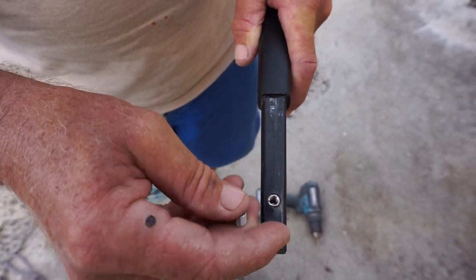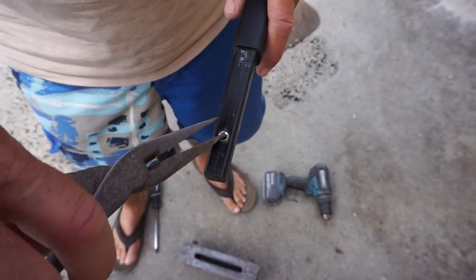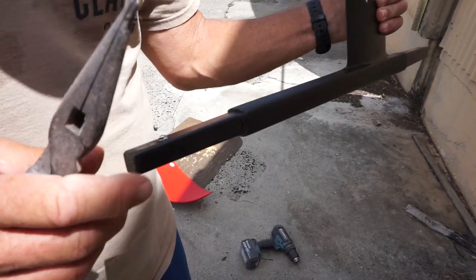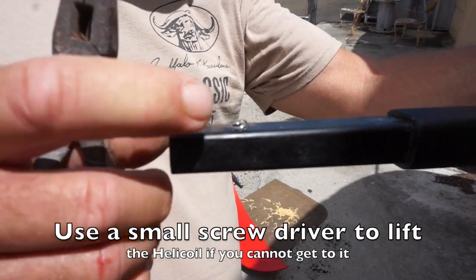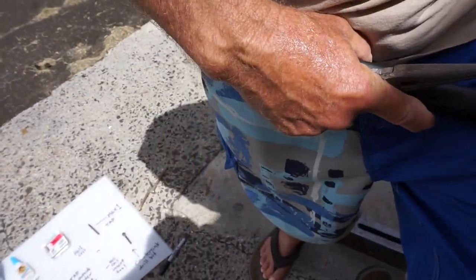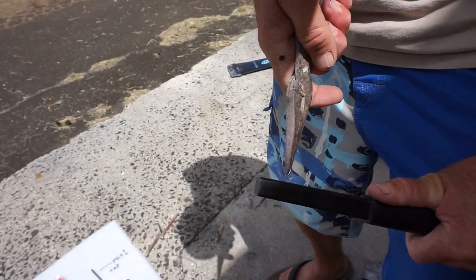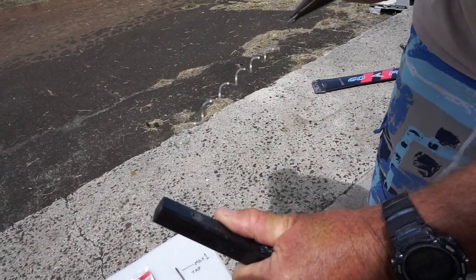So I'm going to grab my needle nose pliers. Now that I can get to it, I'm going to try and lift this up. Through a lot of trial, I finally got this helicoil to come out the bottom side of my fuselage — you can see how it's up. This will catch on your wing. I'm trying to break it — I pulled it up now. This whole spring inside there you can grab with your needle nose pliers. It's going to take a little bit of force to get it out because it's glued in there. Grab it and pull it straight out — now watch, it kind of goes like an accordion. That's what it looks like when you pull your helicoil out.